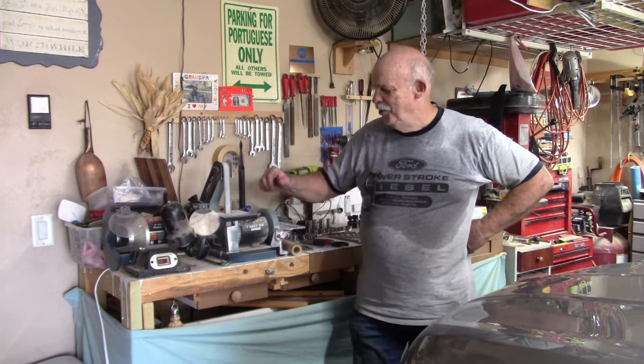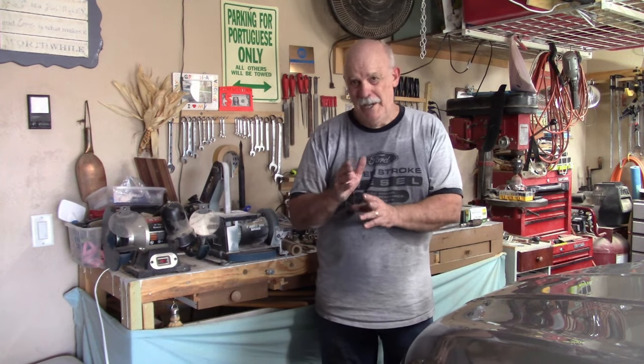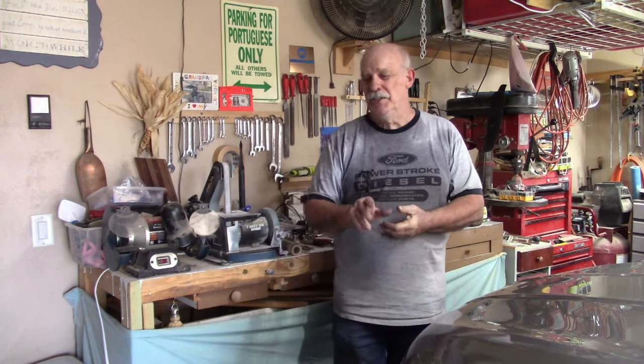So what have we learned? You can do your own brakes if you want to. You don't have to always machine the rotors — every time you machine them, they get thinner, lose backbone strength, and are more prone to warping when hot. Best way to make your brakes last is to go easy on them. Squealing noise quite often comes just from a dust buildup. One tip: when the brakes are cool, spray them with water once in a while, or go through puddles when it's raining. The water gets up in there and helps wash away the dust. If the dust doesn't build up, it doesn't have a chance to form that glaze — that glaze is what causes that high-pitched squeal. Usually you hear it when slightly applying the brakes; push a little harder and the noise tends to go away, because you're dampening the vibrations causing that high-pitched frequency.